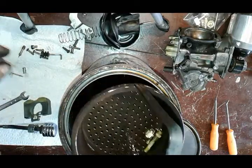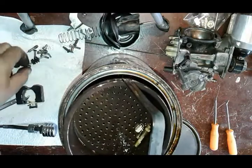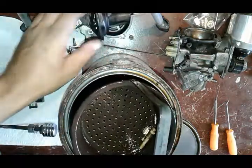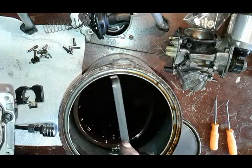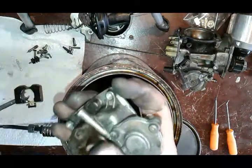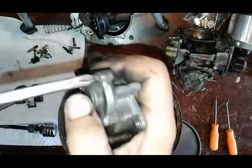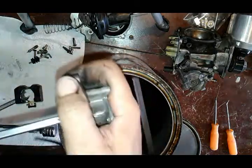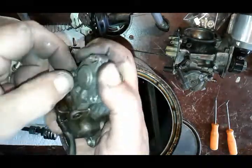The float I clean with carburetor cleaner in a spray can because it obviously floats and won't stay under. Put all the little dirty stuff in the solution. I don't put my needle in there either — I use the spray can. What I forgot to show you earlier — and it's very important especially on this bike because I think that's the source of the leak — we've got to take these three bolts off to get to our acceleration pump. I believe this little diaphragm is bad because it was leaking fuel.